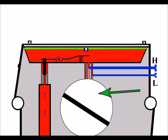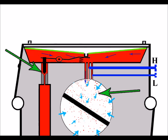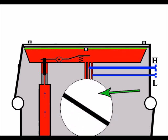And I came to the conclusion this is what was happening. If you can see there, on each cycle of the piston, up and down, each time it needs fuel, it gets less and less. Particularly when you open the throttle out, we haven't actually got enough fuel there to support high revs, because we haven't got the clearance there under the needle valve to allow much fuel through. And of course then, bogged down. And it's quite difficult to believe it's all down to that plunger not being the right length. And unfortunately, it's something that's often overlooked. But that's no longer the case now.